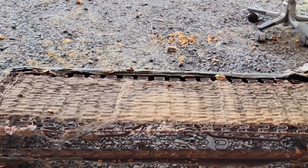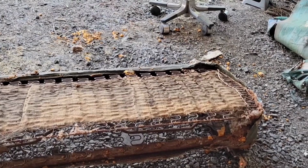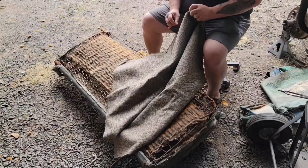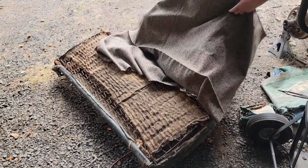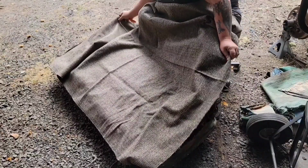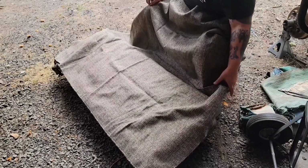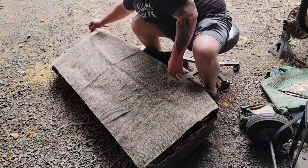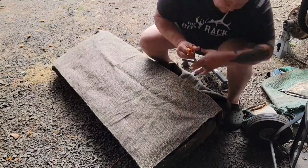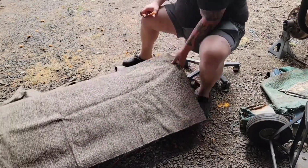Now, the old foam was no good. I had to toss it, foam and cotton batting, but I am going to reuse the original burlap. This original burlap had wires run through it, but I'm also going to add my own piece of burlap. The burlap helps you keep separation between your foam and the seat springs. It keeps it from chewing up your foam. All those bumps and vibrations as your butt grinds on that foam, you don't want to get pinched in those springs and wearing through those springs. So the burlap is a nice barrier for that. It'll help your seat last longer.